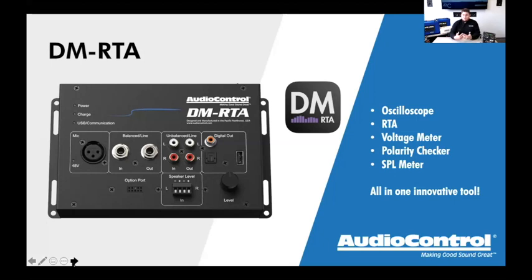If you're working on a 2024 Harley-Davidson and have no idea what that signal looks like — assuming it's full range because it's fed to a pair of 6.5-inch speakers — we don't really know. Maybe they high-passed it to protect those small speakers at high volume. With an RTA that accepts electrical measurements, we can find that out. Holding a microphone up to the speaker itself only shows acoustic response — a drop-off in the low end might be the speaker's limitation, not the signal. Being able to take electrical measurements with an RTA is one of the most important things the DMRTA can do.